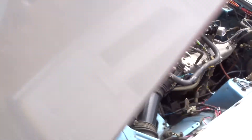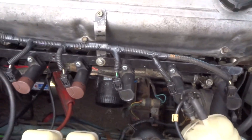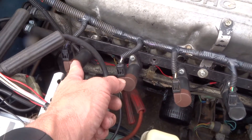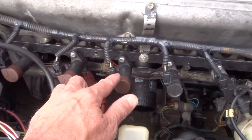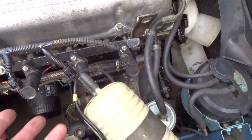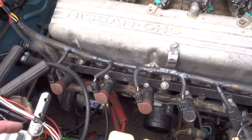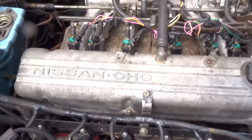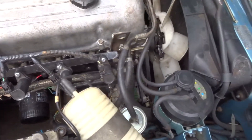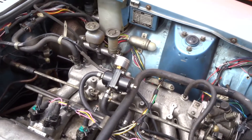On the other side, if we swing round — these coil packs are switched by the computer so they haven't got an inbuilt amplifier. I did start off using inbuilt amplified coil packs but they tend to fail sometimes. These are switched by the ECU which has an amplifier built in, and it's a neat wiring loom too — there are fewer wires going to the coil packs.